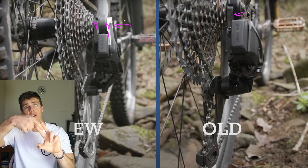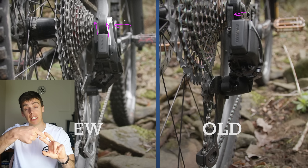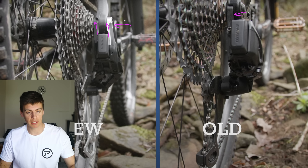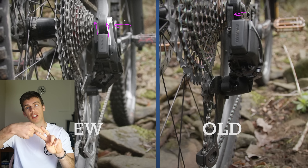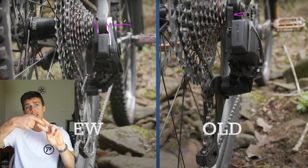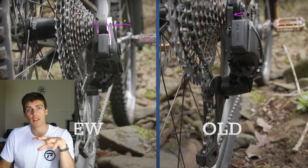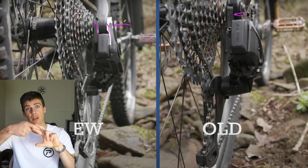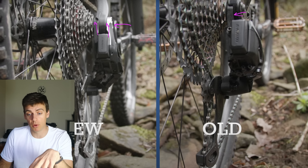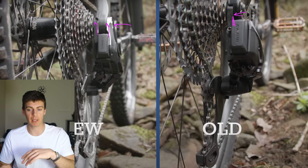If your dropout is a very snug fit, as soon as you start doing the bolt up you'll start to clamp down on the frame. If your frame is slightly looser — and we know, because of bike industry tolerances, that it's all turd in the bike industry — you need a lot of bolt load just to take the slop out of that clevis clamp arrangement. Unless I'm mistaken, there are no wedges; you can't space that gap anywhere. You just need to do the bolt up tight. That's what I don't like. We don't have that problem on a normal mech because it's a single-plate design — you do the bolt up and as soon as you apply any sort of bolt torque, you get clamping to the rear mech hanger.